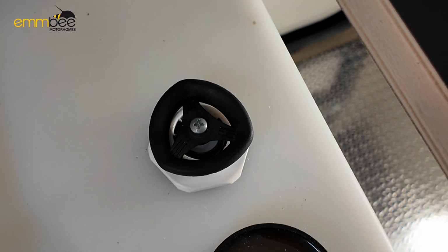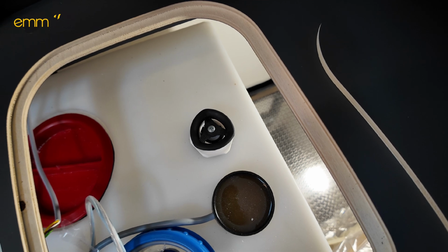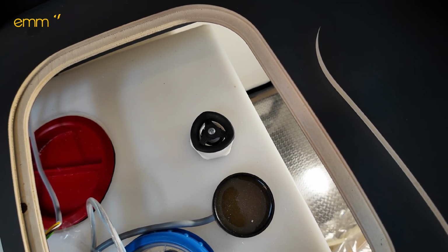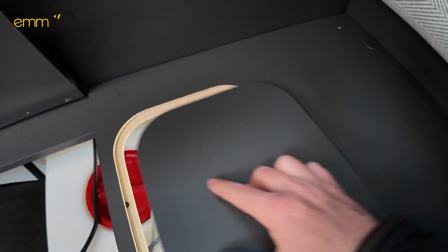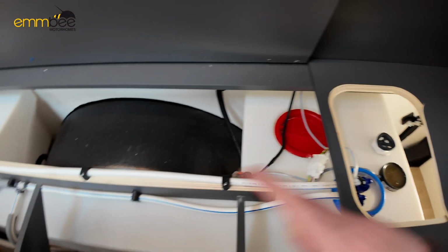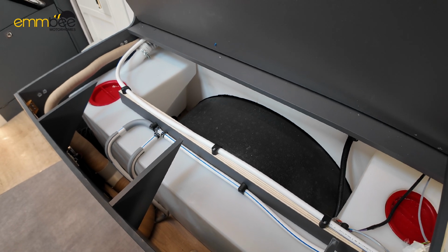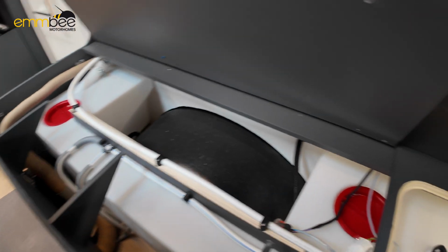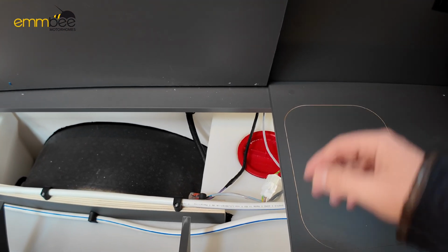If you are planning on travelling back from a campsite because you are going home and not using the van, it's good practice just to open all the valves just before you set off on your way home. Because the tank is so long, the movement in the motorhome, going up a hill or moving around while driving back, will help get all the water out with the valve open.